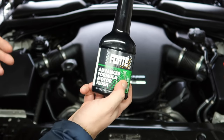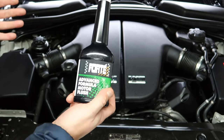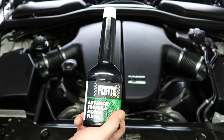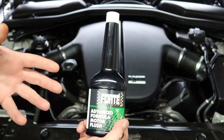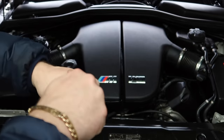If you are looking to do an oil change, I do recommend not using this product — not Liqui-Moly, not Wynns. Try to avoid an engine flush if you can. The best thing to do if you want to flush your engine is to get extra oil, buy it in bulk, let that oil work itself around the system for at least a week, and then change it again. That's the best way to actually flush your system.